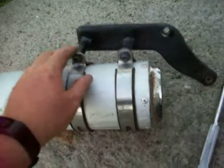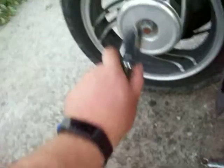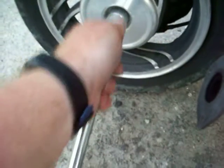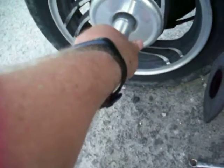There's two bolts. So, as I said, the entire bracket will come off, and you don't have to unscrew these two things. So, put the 15/16 socket on it. Well, looks like it's not a 15/16, so it looks like it is a 13/16.